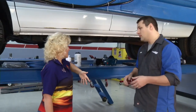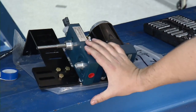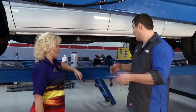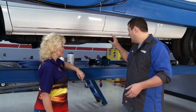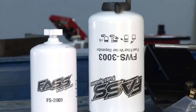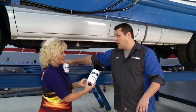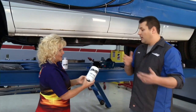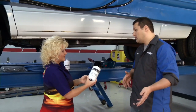This won't go back into the tank — it's going to mount somewhere underneath the truck. The stock configuration had the transfer pump retrofit into the tank. We're going to put a draw straw in to pull fuel from there, and this is going to mount on the frame rail underneath for easier mounting and easier access to change the fuel filter. There are two filters on this system: a three-micron fuel separator and a 150-micron water separator to pull contaminants and keep water out of the system.